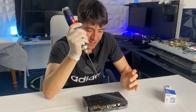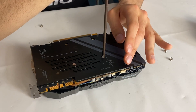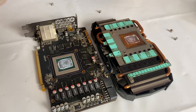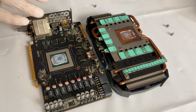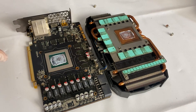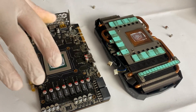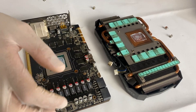For the next step we have to disassemble the card — you don't need to wear gloves for the disassembly itself. Here is the inside of the card. I'm wearing gloves to remove those thermal pads. As you can see, even though we washed the card, the thermal paste hasn't gone anywhere, so this is for everyone who says you should disassemble first — as you can see, you don't need to. But what you do need to do now is disassemble it, get rid of all the old paste and pads, and then we're going to heat up the card.